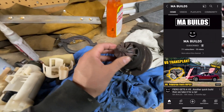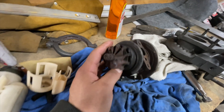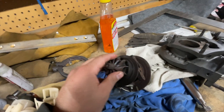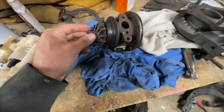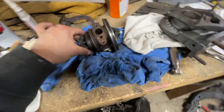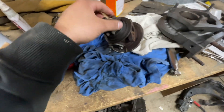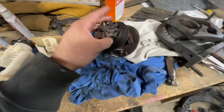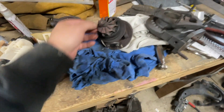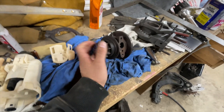So these turbines — the hot side — these are ceramic for the J-spec motors. He was hammering it out and it just rubbed up against the housing. Luckily we have the other turbo, so we're going to basically pop this off, remove the shaft, and just pop in the new one. That's the downside to these — you can't really boost really hard on them because these turbines will essentially explode. They're such a weak, really brittle material.